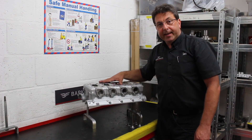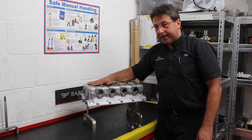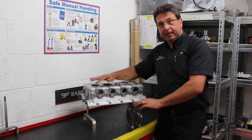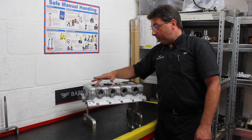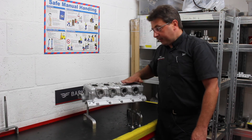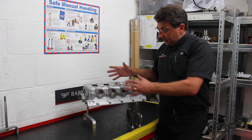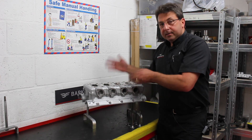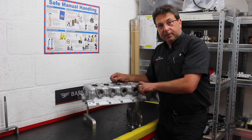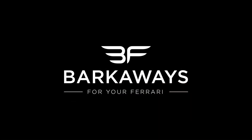The next piece on the heads is doing the tappets. We've got our valves in — new solid valves — valve seats cut, each valve seat finished by hand. Now we'll wash the head out again to make sure there's no grinding paste in there, all surfaces have been skimmed and are dead flat, new studs going in. Then we'll turn it over, fit the camshafts and adjust the tappet clearances.